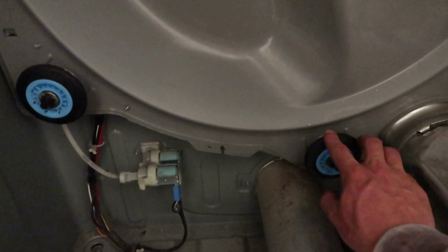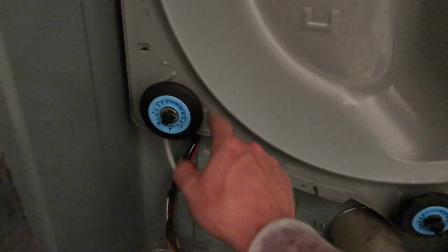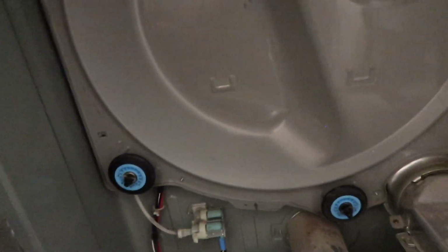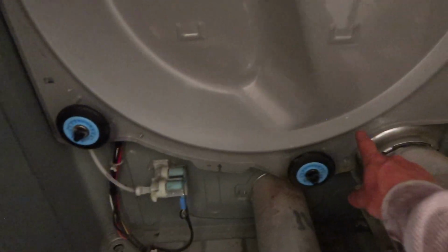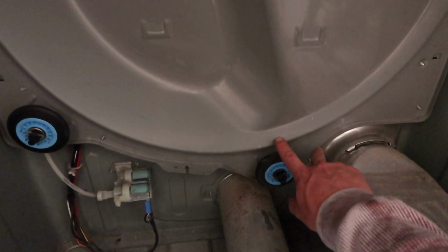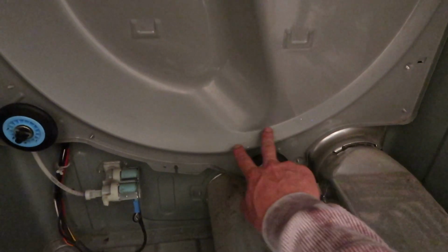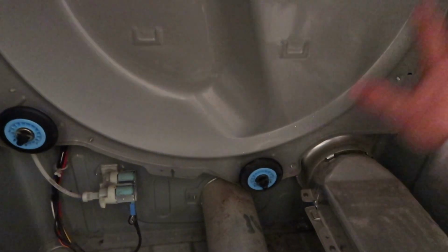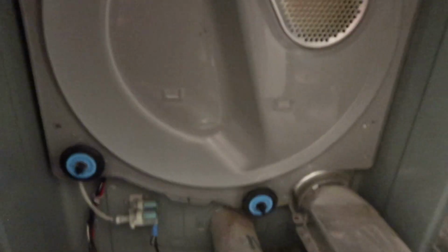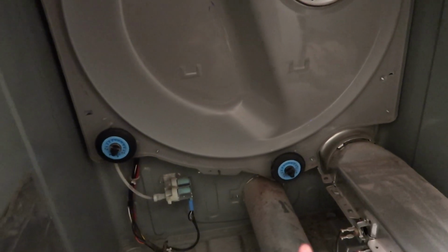So here's what is actually making all of the noise in the back of the dryer itself. That crack will come down and one side will be high and then the other one will come through and they'll smack across each other. That's what's causing the thump in the drum part, if the drum's broken. And it will happen on both of these. But with the drum perfectly aligned, hopefully it wouldn't do that.